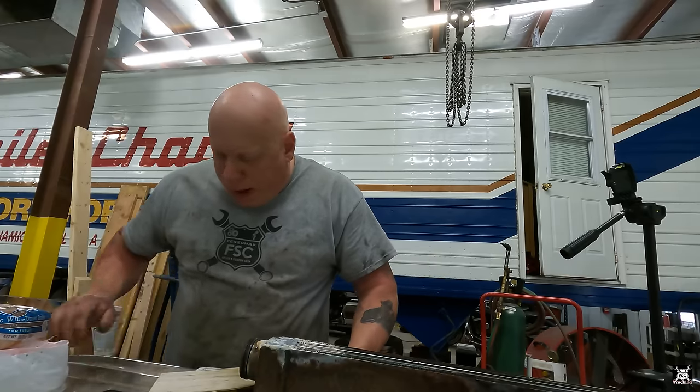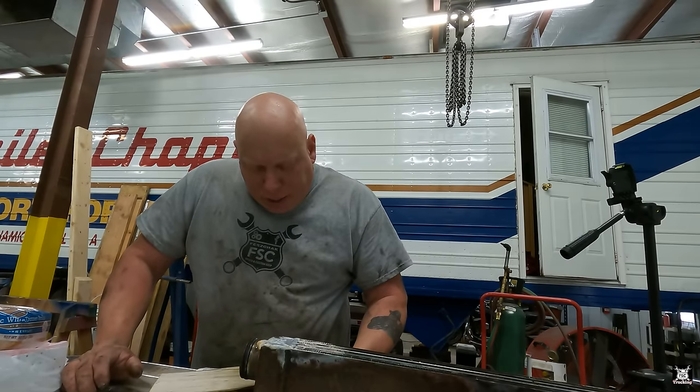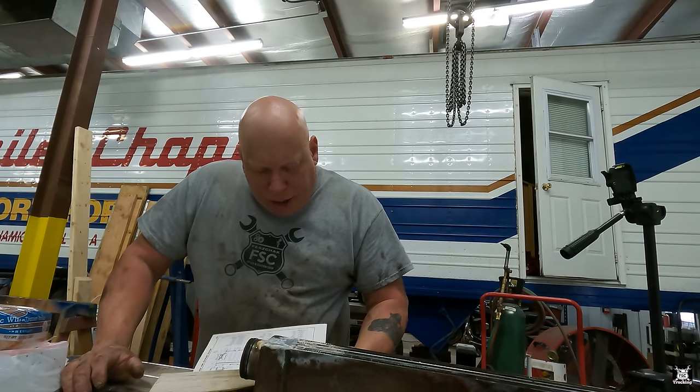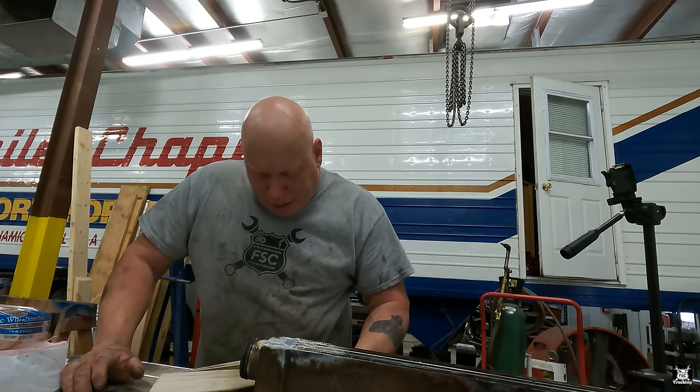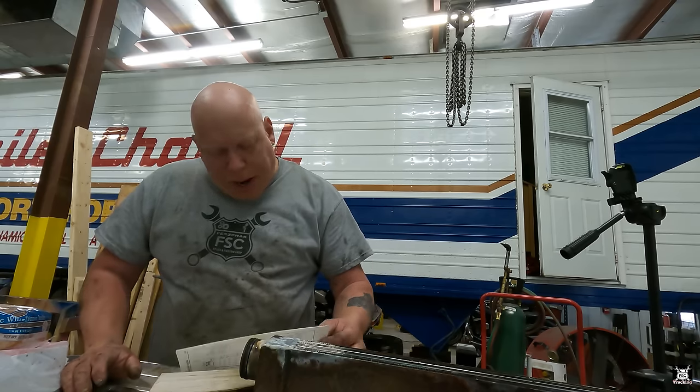Got an old B model Cat. I've been working on fixing a boost leak, and when I took the heat exchanger, the intercooler, apart, the core apparently is shot also. It's putting antifreeze down in cylinder one. So I need to order one. G told me he can get one.